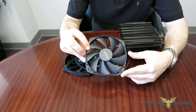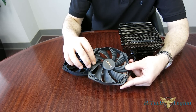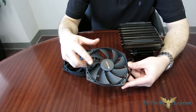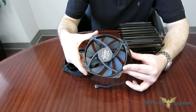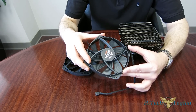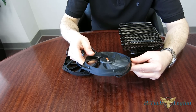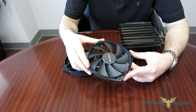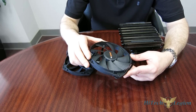Taking a look at the components — Be Quiet's Silent Wings 135mm fans with the Be Quiet grooves in the fins that we've seen so many times. Really nice-looking fans, incredibly silent. The ratings on them really aren't aligned — they look like a misprint — but Be Quiet is actually very stringent in their testing, so you don't get exaggerated numbers when looking at their fan ratings. Very smooth, very quiet. They also have an incredibly low startup speed — we were actually getting these to start up using PWM at about 325 RPM.